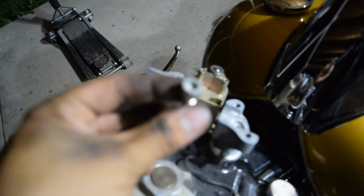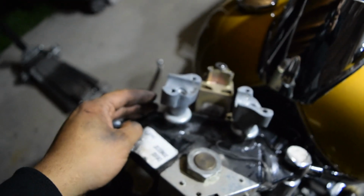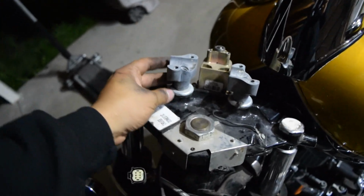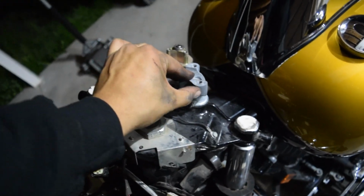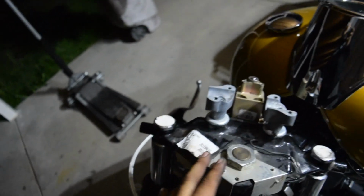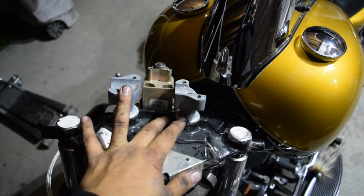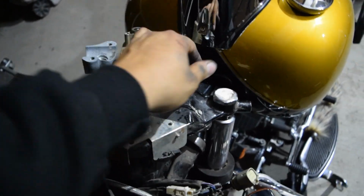You just take the four of them bolts off, and she comes off, you know. So what I'm gonna actually do right now is, I got these loose, and I'm gonna go ahead and change out the bushings for the solid ones. It's probably a good idea to loosen these up with the bars on, because they were kind of a horror to do by themselves.